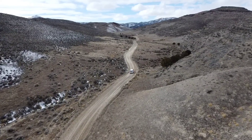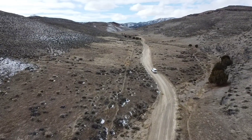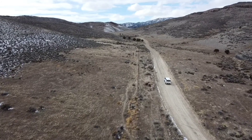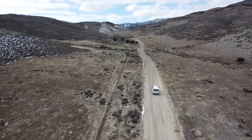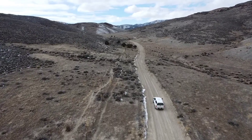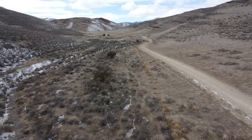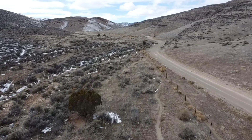In the rain, these tires do really well compared to the traditional BFG AT tread design. As far as miles per gallon, gas mileage wasn't really affected all that much by the tread design. The tire is a little bit heavier than what I was running before — I had some passenger-rated tires at stock size, shorter and quite a bit lighter. These are LT tires and an inch taller, so I did lose a little MPG, but only about one MPG over the stock tires, which for all-terrain tires is not that bad.